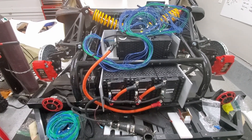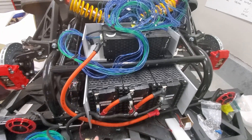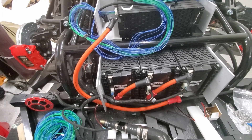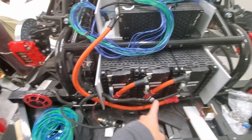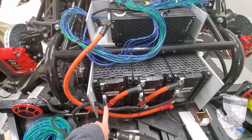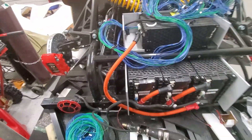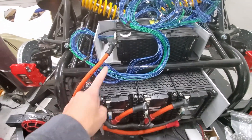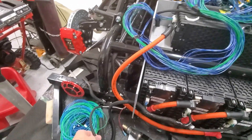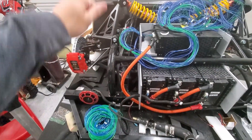Someone mentioned: are you going to make an orange cable? My initial thought was no, because each cell is just 3.8 volts. But somebody else mentioned that if you stack them, from ground to 3.8 volts, once you get to the end it's going to be roughly 400 volts from there to there. I don't know if they make orange split loom that large, but maybe I'll just put a piece of orange tape or something on it.